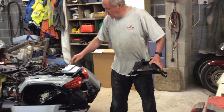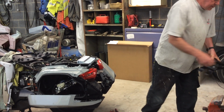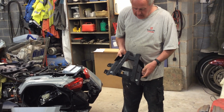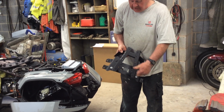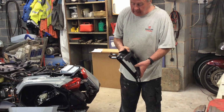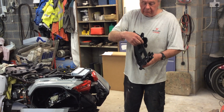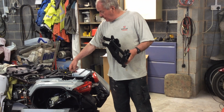As you can see, here's the brackets here. That's the 2 flat bars, just simple enough. On the rack, I've replaced these. These are 4 8mm, and I've replaced the 2 front ones with 10mm, just to give a bit more oomph, really. But that's it. So there's quite a lot of space under here. You'd be surprised, actually. 8mm isn't a problem. You can still just about get your fingers underneath.